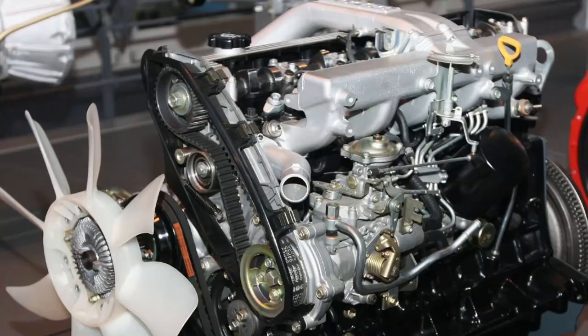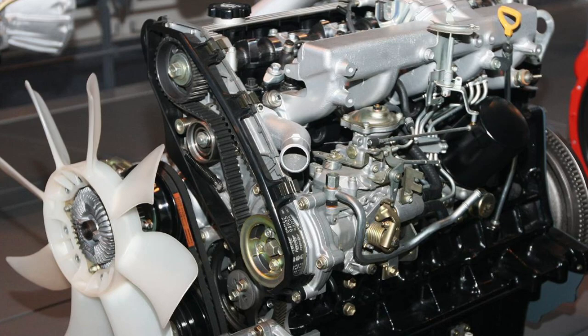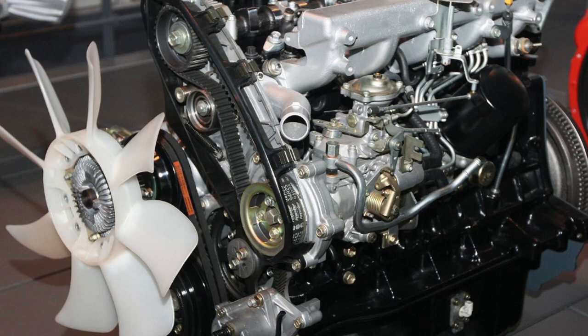For switch 3, I decided to make this control the radiator fan. See, in older muscle cars like the Mustang, the radiator fan was spun directly by the engine's crankshaft. This was extremely inefficient, as it sapped 5 to 10 horsepower from the motor and spun in time with the engine, meaning it would spin slower when the car was at idle, where a high-speed fan is needed the most. Switching from a mechanical fan to an electric fan gives you slightly more power and improves cooling for your engine, giving your car a slightly longer life.